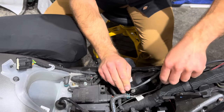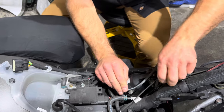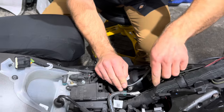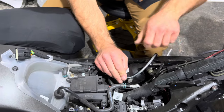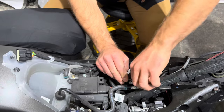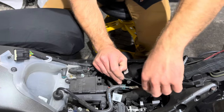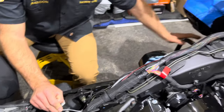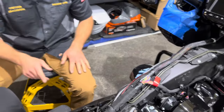And then I like to pull this antenna wire on the inside there of this fuel overflow line. And then we're gonna follow that with our speaker wire harness, because when we jump from here, we're gonna put a zip tie here, and then we're gonna zip tie these two together all the way up the backbone. So let me grab a couple of zip ties.